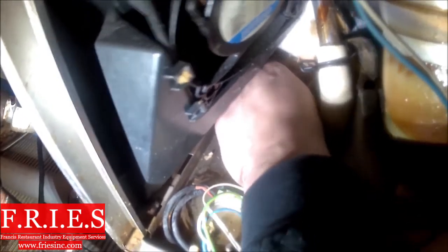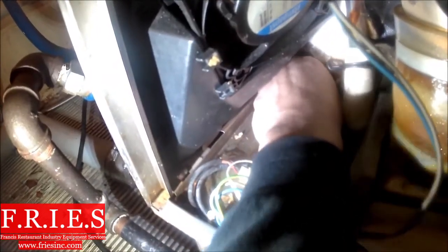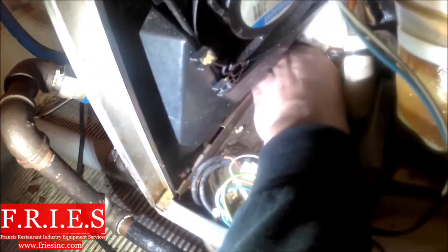So I'm going to go ahead and change out this clean jet pump. We have power there, we have water there, it is not pumping up. There's just a 10 millimeter bolt here and then this little bracket slides off. Once we do that we're just going to disconnect some hoses and the thing slides right out. Really good design on how this thing comes out.